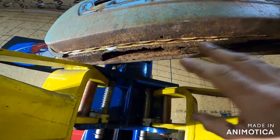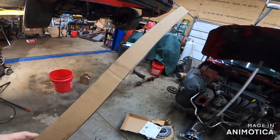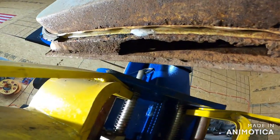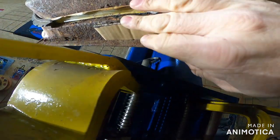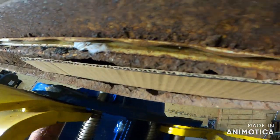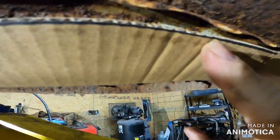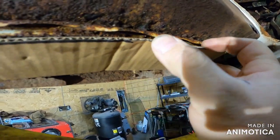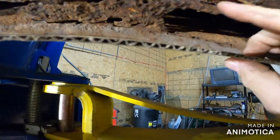We're going to measure this out and start taking it to fab. We're going to save these doors — period, I don't care what it takes. So give me a few minutes and hopefully we come up with something. We got our first pattern. You may notice this side is more narrow than this side — the reason why we dug that is because of the rust. Here's my theory: since this has got a lot bigger hole than this back here — giggity — we're going to slide that right in here and weld right through that once we get this cleaned up. But there's some places that do not have a place to weld, so we may have to weld further up on this actual lip here, or make a bend in it right in here somewhere to make up for this extra.